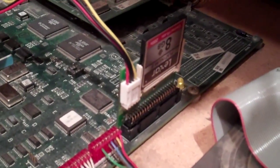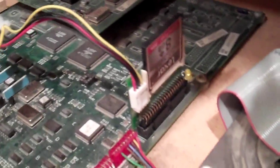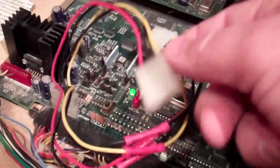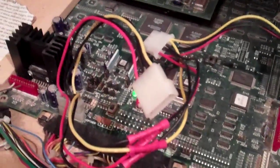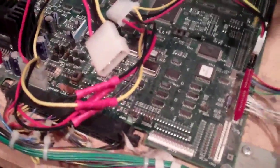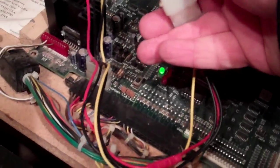Additionally, this thing uses a floppy drive power connector, meaning it needs external power. I didn't have a straight IDE to floppy connector, so I took an old power supply, hacked it apart, and reconnected it to a male-to-female adapter so I have both ends. I used a USB IDE external drive enclosure to actually write the image, and I crimped the two together. I've got two leads here for extra length but it works fine.